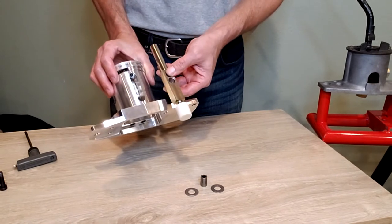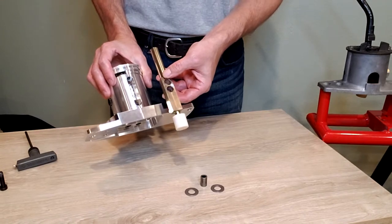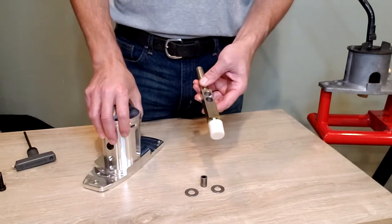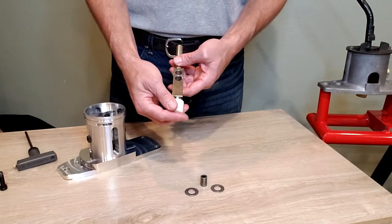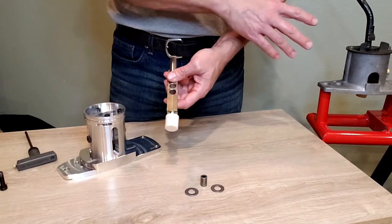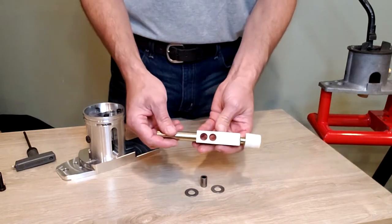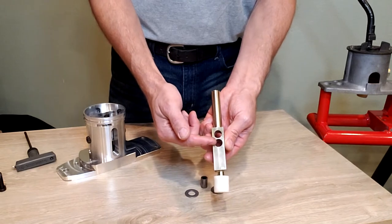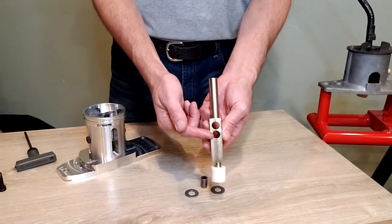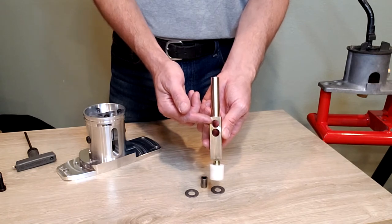All we do is change the fulcrum by moving bushings and the bolt from the upper to the lower as needed. If we were to move the stick up and down, we would change the placement of the bushing in the cup in the car and things just wouldn't work. So there are two holes — the lower hole is how the shifters are delivered, that's 20% throw reduction. The upper hole is approximately 33% throw reduction.